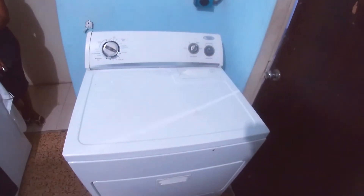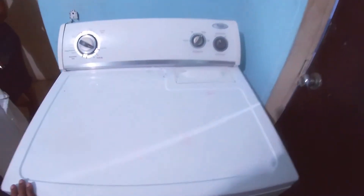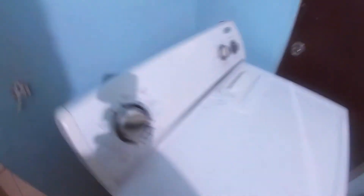One of the safety devices may have changed, whatever it is. We'll take a good look at it, see exactly what is going on, and advise the customer how much it might cost - that kind of thing. So this is the item we're looking at here - it's a dryer. It's not heating, so we had to pull apart the entire thing and get down to the fuse.